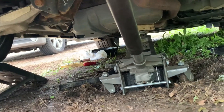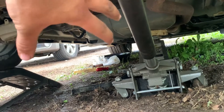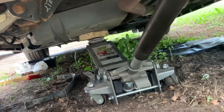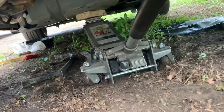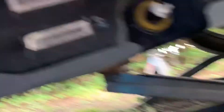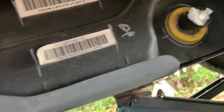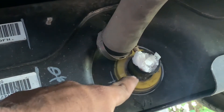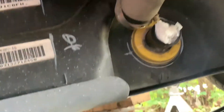The tank goes from one side to the other — it has the bigger, beefier part on this side and a slimmer portion on the other side. We are now on the driver's side. The first thing I did was loosen this hose clamp bolt right here and pull this filler neck off of the tank. I put a bag in here in case some fuel came out — a little bit came out but not much.